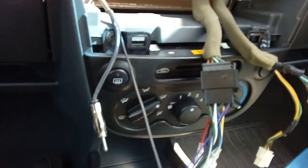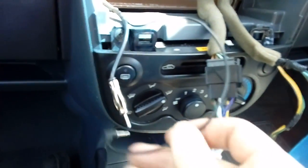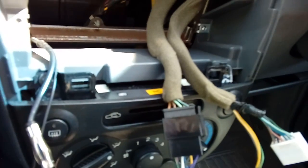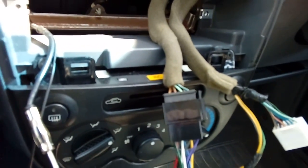We've plugged in your power cable that comes with the radio. This particular one has a Bluetooth microphone, so we've run a little microphone cable all the way down underneath the dashboard, then up the screen pillar and across, coming out near the mirror. The reason I put it near the mirror instead of the top right-hand corner of the windscreen is because when you open your driver's side window, the noise from the air rushing past can interfere with the microphone picking up your voice clearly.